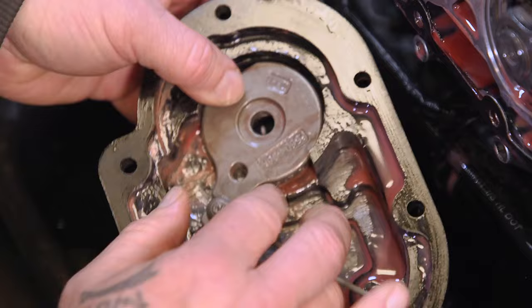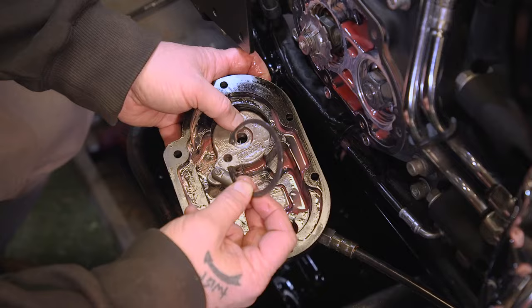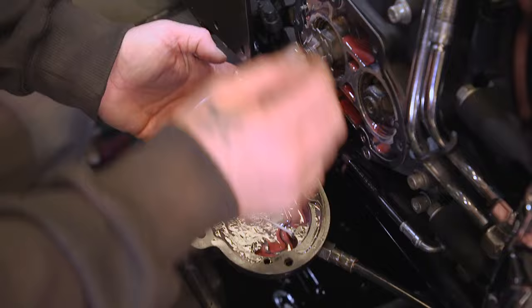Now we're gonna put our big C-clip back in the groove. That can be a little tedious, just make sure you get it in there. And then we'll put the cover back on the end here, torque everything down, and we'll be ready to make our clutch adjustment, which, like I said, I'll put that link in the description.